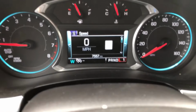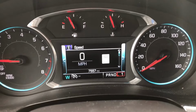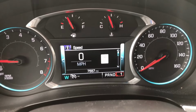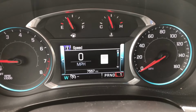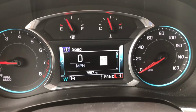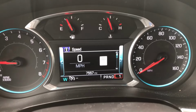Right now, if you notice on the screen, my vehicle says it's on L1. It's because I just barely put it on low. Since I'm at a full stop, the recommended gear for my speed is first gear. The reason I said you can do it while driving is, say you're getting off the freeway and you know you're about to hit a bunch of lights and don't want the auto stop to engage. The vehicle will find the gear that is appropriate for the speed you're doing.